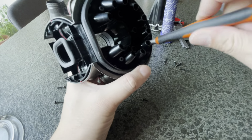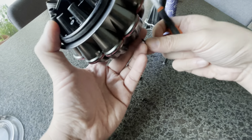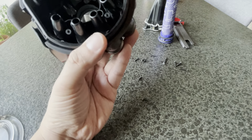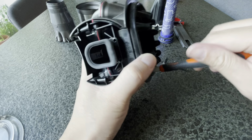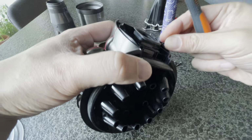It's all over, the vacuum is full of T8 screws. You need them. These are not the best because this thick part here actually rubs against the plastic. If you have a straight Torx screw, that would be the best to use. Anyhow, let me just put the screws in first. Just gently turn them in a little bit, and then the last 2 front screws is T8.